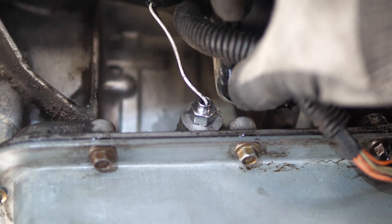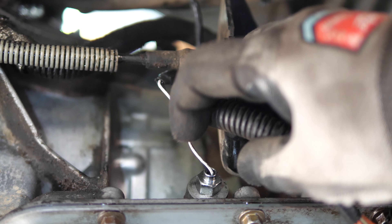I've had zero issues with this gauge and yes, although I'd like to upgrade it to something nicer eventually, this thing has been flawless. The third part of this three-in-one is a temperature channel — you can add coolant temp or, like I did, put it on the transmission. That's to see how hard things are working. I'm happy to report my transmission temperature runs around 150–160°F, even going up and down hills. I've had zero issues with it.